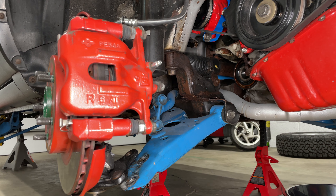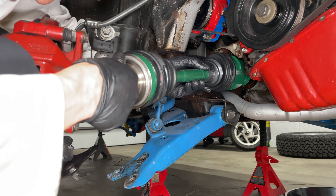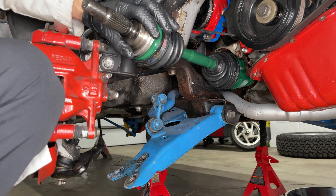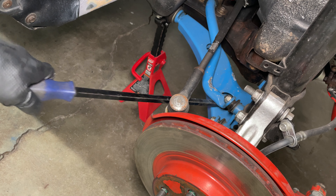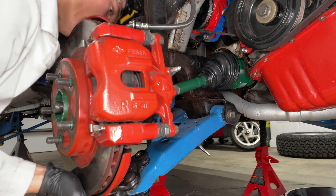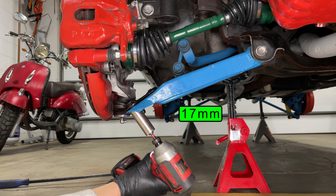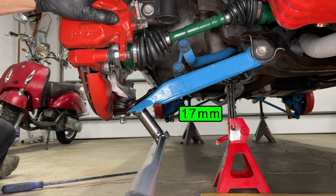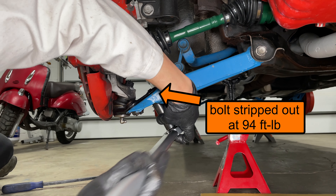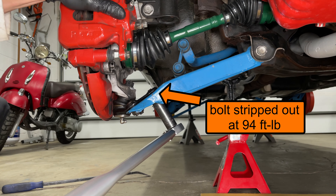Moving on to the front of the car, pull the spindle back to make some room and hold it back with your knee as you slide the CV axle into the transmission. Push the axle toward the engine and hold it as straight as possible. Give it a few gentle taps with a sledgehammer to push the locking clip into the transfer case. Insert the splined end into the hub. Insert a big pry bar into the hole in the control arm and push down. Turn the ball joint as needed to line up the bolts with the holes in the control arm. Install the two nuts and one bolt into the ball joint. The Toyota factory service manual says tighten these to 94 ft-lbs. Unfortunately, my AutoZone ball joints couldn't handle that much torque and the bolt kept spinning. Every time I fix something, I create another problem — I guess I won't run out of videos.